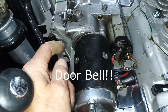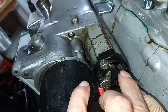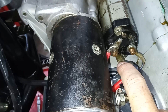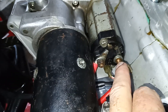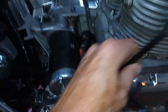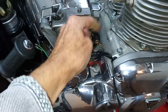It's important to note that there's a small spade connector here, and above it is written 'ign' — ignition — but that spade connector stays unconnected, so you don't use that one. You just use the big spade connector at the bottom for the white and red, and the brown and blue goes to the screw terminal. The big battery live cable goes to that terminal as well, all running under the starter motor. The cable from the alternator will also go under the starter motor and connect up at the back.